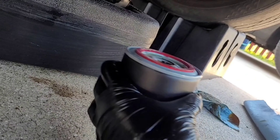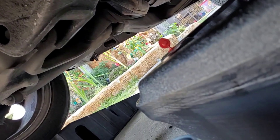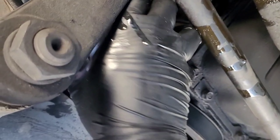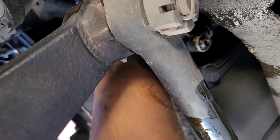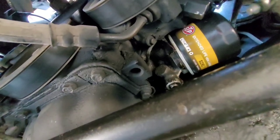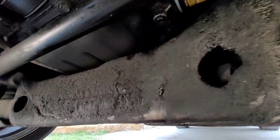We've got the oil filter right here. We're going to get it in there — angle it to make sure we get in contact with the threads, then thread it in. Once the oil filter is installed, tighten it down by hand. Wipe it down and make sure there are no leaks — in this case it doesn't look like it's leaking. Wipe down the surfaces where oil did drip.